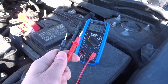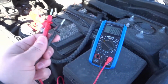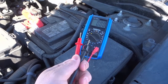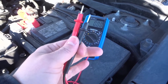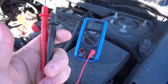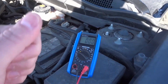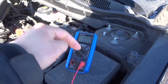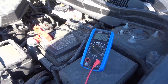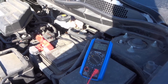So that's the super easy way to test the battery: get a multimeter, set it to 20 volts, touch the probes to the appropriate posts — it should read about 12.6. Then crank the engine and make sure it stays above 10 while cranking, and it should jump up to about 14 once the engine has started. If you liked this tutorial please give it a thumbs up, let me know what you think in the comments below, and subscribe for more car and driving videos. Thanks for watching!